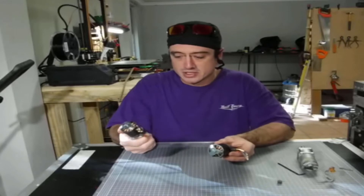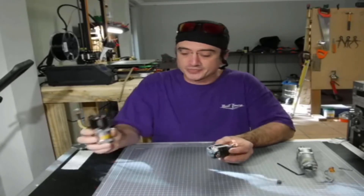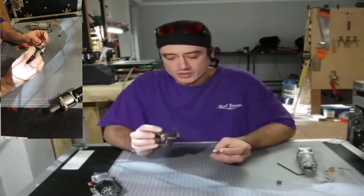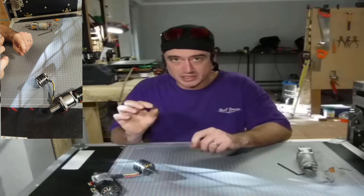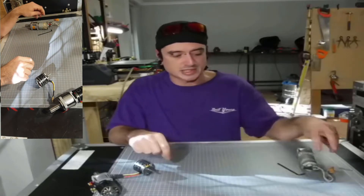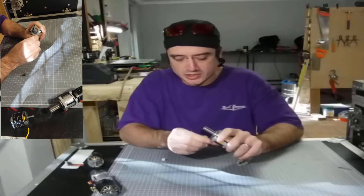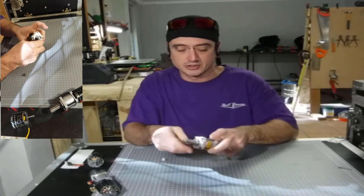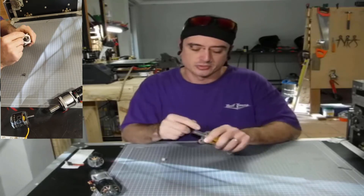I'm sold. I've only used these once in competition, I haven't failed and I'm going to use them again. This motor has a 5mm shaft, so you need a 5mm pinion that matches your Banebots P60. First things first, we need to undo these screws so we can pull the gearbox apart and pull the motor out.